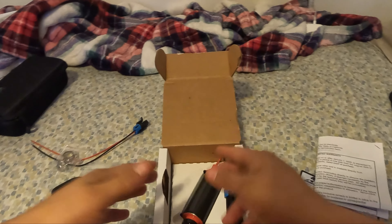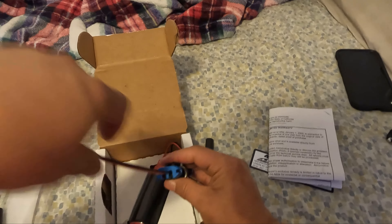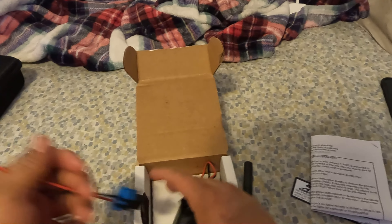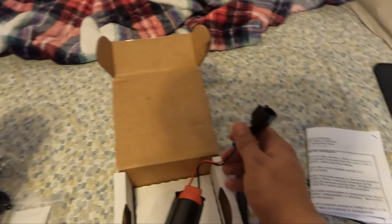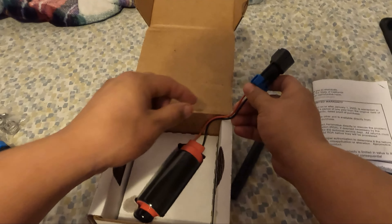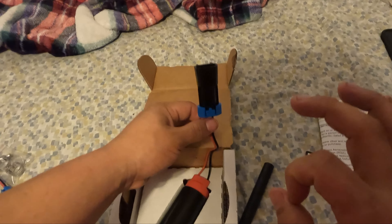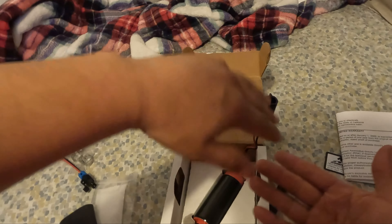For installation on a Fox Body, what I'm going to do is snip the pump's wires down to a useful length, because there's too much excess cable to leave inside the fuel hanger. Measure twice and cut once — don't cut too short or you'll have no cable left and have to start over. Leave yourself a little extra for error because you will need to strip the wire and connect it to the hanger wiring, and you want a solid connection.